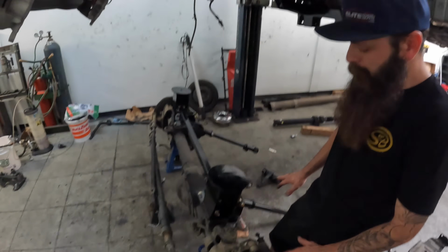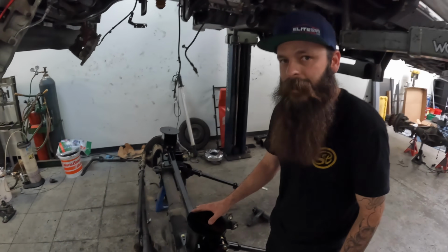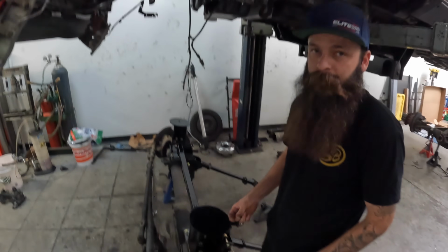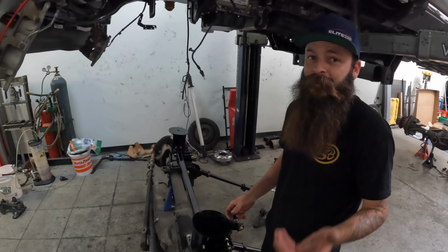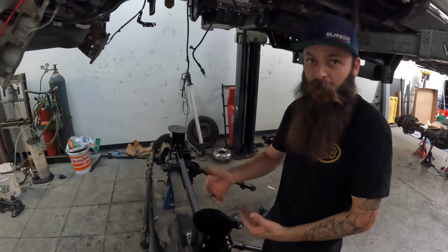What you want to do is when you go and drive it for the first time, a couple hundred miles or whatever, you come back and you look. Well, there's a lot to look at. So we got a squeaker, rattle, or we don't. Hey, it's in here for retorque. Okay, well, I'm not going to retorque every bolt on this kit. I'm going to look and see if there's anything loose. And like your old truck where it broke the arm, the shock mount, we didn't know until the rust and the bolt came out.